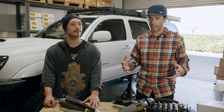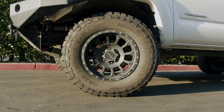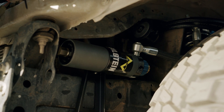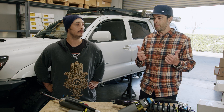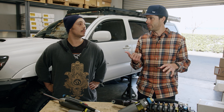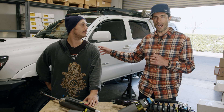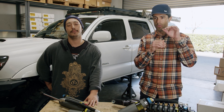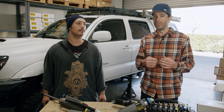On this Tacoma, I'm only concerned with lift height on the front in order to clear these 33-inch tires and make sure there's not a lot of rubbing at full lock. I'm not trying to run 35s or 34s, so I'm looking for the minimum amount of lift to clear the tires at lock — if I can get two inches of lift, I'm good with that, because it allows the front suspension to do its best. These are recommended not to go past two and a half inches of front height from Bilstein on a second gen. I experienced a lot of top-out when I was pushing the BP51s to two and three-quarter to three inches of lift — the front wheel would dive out pretty quickly — so I always keep that in mind with preload.